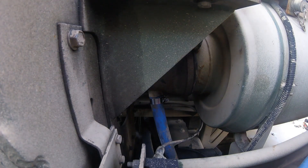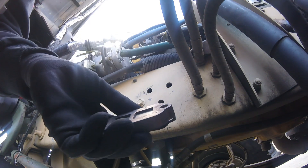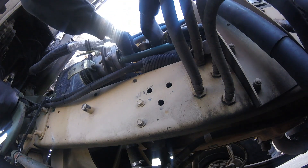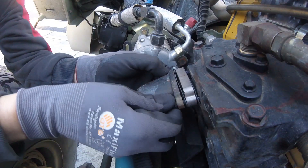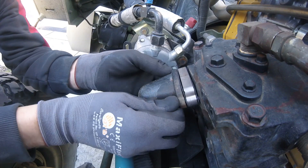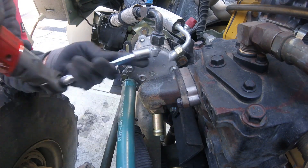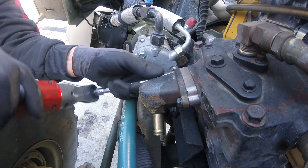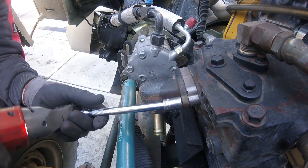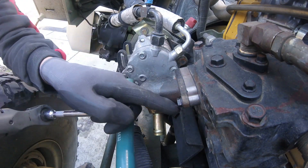This is just intake, so it's just providing a small vacuum. See the little notch right there? They want it facing out and up, so the words on the inside will be upside down, if that makes any sense. You're basically just sandwiching this check valve inside the intake for the air compressor. I put some Lucas Red and Tacky on the bolts. Not much torque is needed — it's just an intake. 25 foot-pounds is plenty. Those bolts and those washers come in the package.